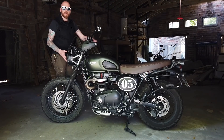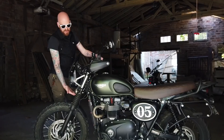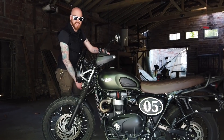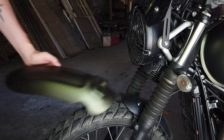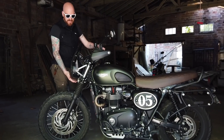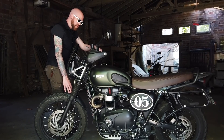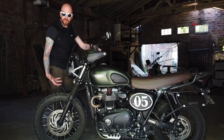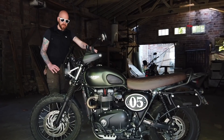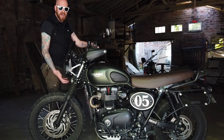But the high fender does not bolt on to the 2017 or 2018 models. On the newer model there are actually bolts under here that you can just bolt the high fender on, because the rectifier is hidden behind the radiator. I was hoping it would be the same size as the stock fender so I could use the British Customs high fender bracket that I've been using, but it doesn't fit unfortunately. When you buy the high fender piece you get the high fender in whatever color you choose and you get a low fender just to protect the radiator. The low fender works just fine — it's the same mounting points as the stock fender on the 2017 and 2018 model — but unfortunately the high fender just doesn't work.